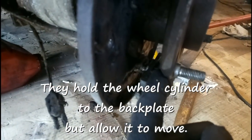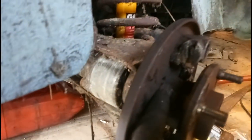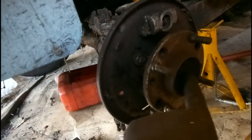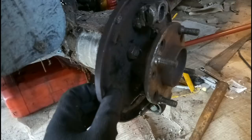See the little two tabs? So they're off — only minor violence needed — but the wheel cylinder won't pass the drive hub. I think I'm going to try loosening the back plate, see if that will give me enough angle to get them out, because that's quite annoying. I can't really see a quick way of getting this off. It seems to be all part of the hub.